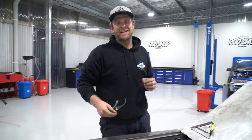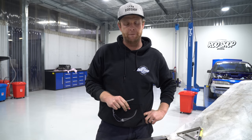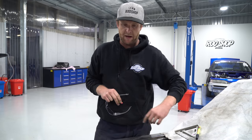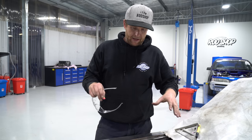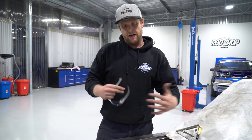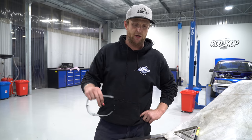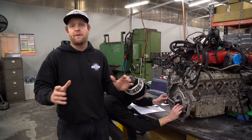It's never easy cutting up a complete car, but we have put the V12 in it so sacrifices need to be made. I've put the brace in like we spoke about so the chassis rails didn't move - we haven't measured yet but that's it. It's only a rough cut, we'll obviously have to take more out, but little bits at a time. We'll get the engine back when the boys at the machine shop are done, slip it in, and hopefully that dry sump clears what's left of that cross member.